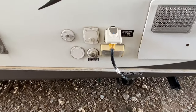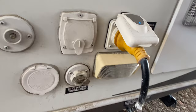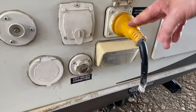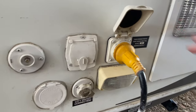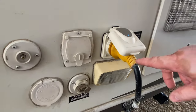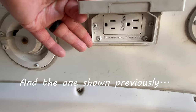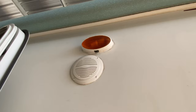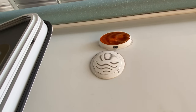When you're plugged into what they call shore power - like we are here, with power running over to a little light pole - the shore power coming in is using a 30-amp plug and it is 120-volt AC. When you're plugged into shore power, your electrical outlets will be working. Some of your exterior lights will also be working, but wait - those run off 12-volt. How do they work when plugged into shore power? There are actually two ways this happens.